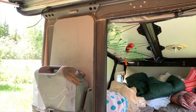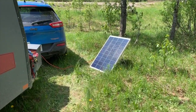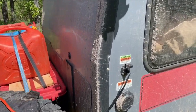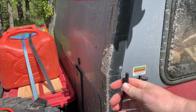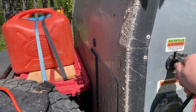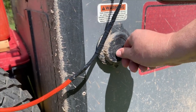The battery is a Group 27 AGM. I'll drain it with the fan and charging in a few nights, so I bought a cheap 100-watt Costco solar panel and that seems to keep me topped up. I put an extension cord on it because the solar is wired for ZAMP, and the only real difference is the connector is reverse polarity for ZAMP. So I just wired in my solar panel with a charge controller backward and it works. There's also shore power here — a 30-amp connection that comes with about a 15-foot cord to plug in at home, which is nice.